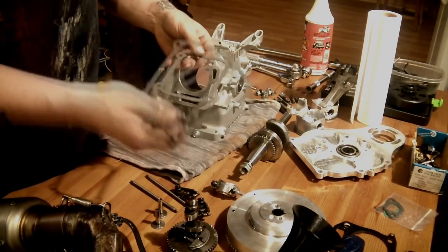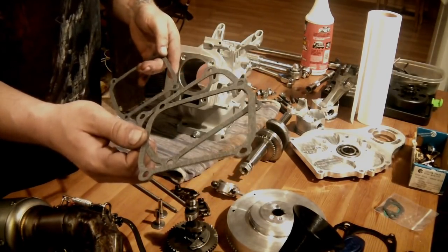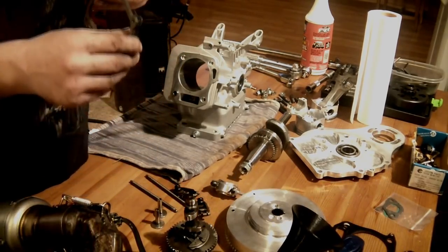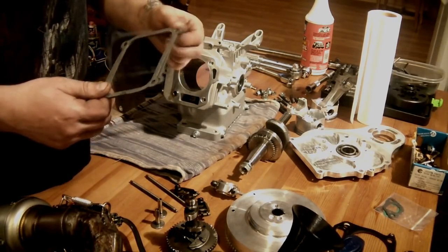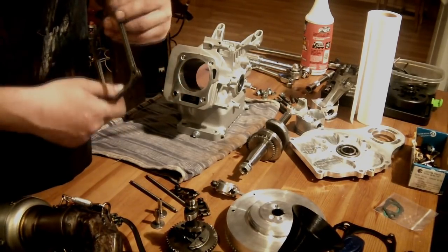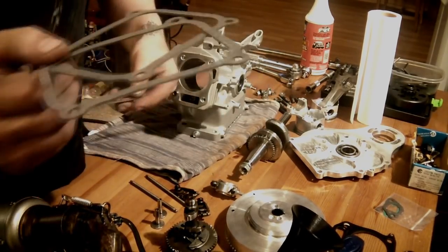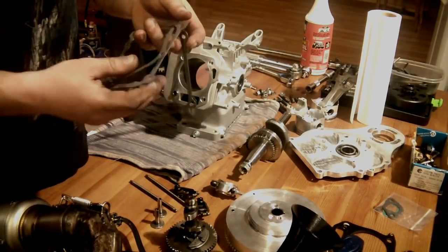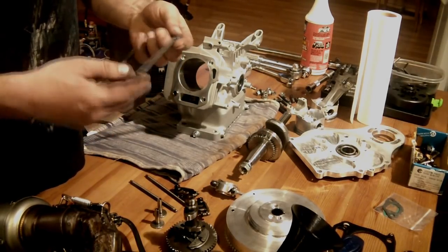Valve cover gaskets — I actually found these on eBay. The ones for the Hemi head are total bunk — they're cork. The ones you can get aftermarket are also cork and kind of thick. On a paramotor there is a lot of vibration so the screws always come loose. I switched to using super glue on those bolts, which is really frustrating because that comes loose a lot. But these are a nice gasket material and not very thick — you get three for like five bucks.